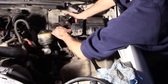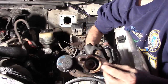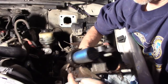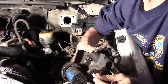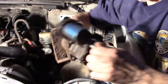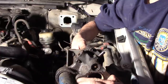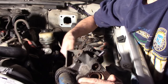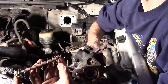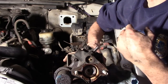Everything's loose under the dash — this should just pull right out of here. There we go. This is the accumulator, and you can see how wet it is around that — that's where this was leaking. From under the vehicle you can see drips hanging right here, dripping down on the frame. Now we will take the new unit, take the cap and plugs out of the lines and return, and plug up this original unit to put it back in the box for the core. One item I had to take out is the push rod that actuates the master cylinder — it fits down inside this bore; the new one doesn't come with it, so pop that out and transfer it.